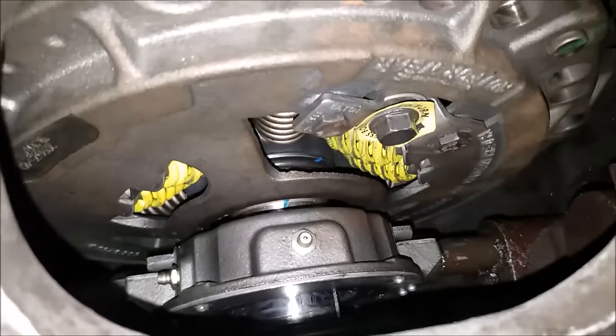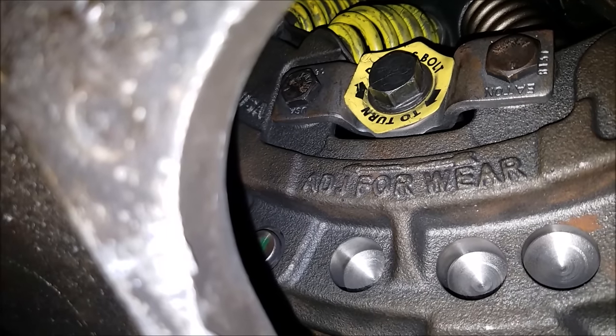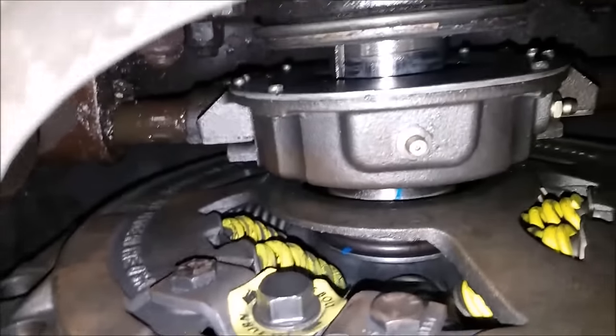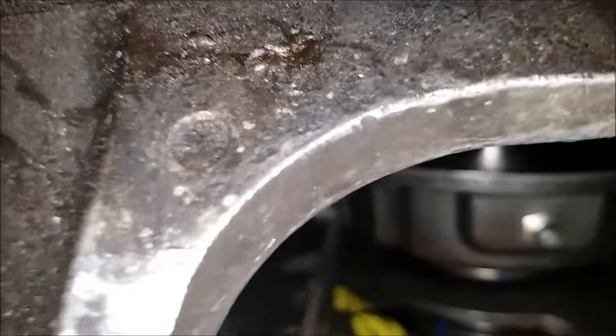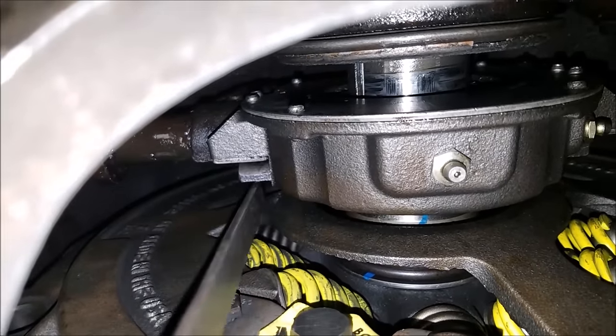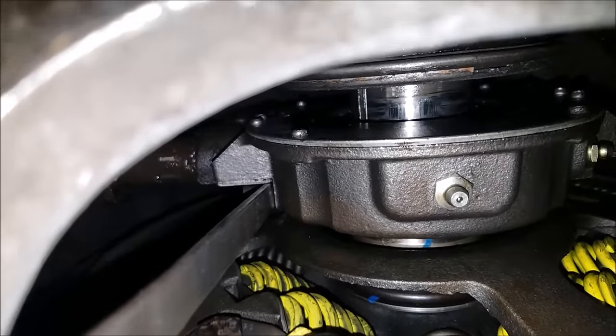So come on down — we're creeping in on the creeper and we've made it to the inspection plate. Right there is your quick adjust. You've got to push it in and turn it clockwise or counterclockwise to adjust it. I'm going to use this bar to show you where to go — we're going to check the spec right in between. This is your throwout bearing or release bearing, and these are your forks right here. This is the measurement we're going to take on this side, and that is in spec. You don't want that more than an eighth inch — this is an eighth inch bar.